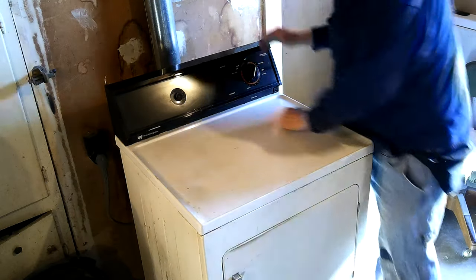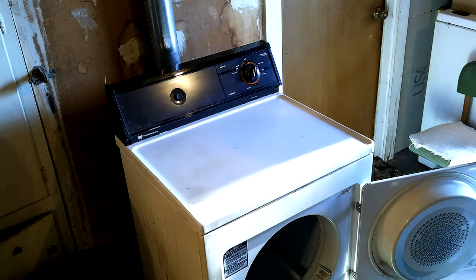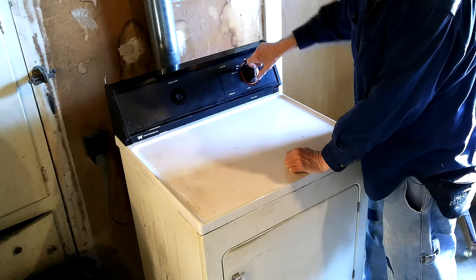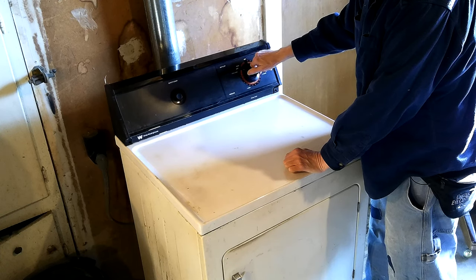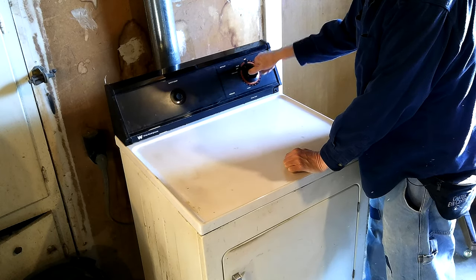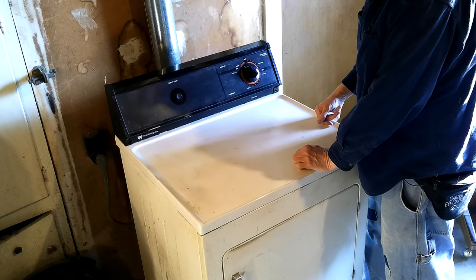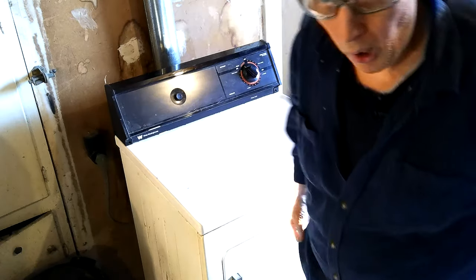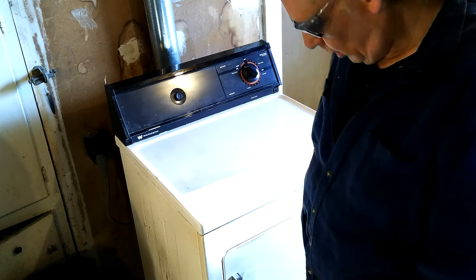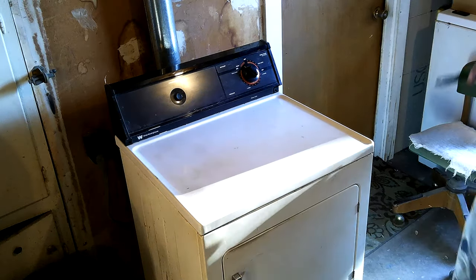Okay, that's hot enough - I'm starting to feel the back warming up. Hopefully that burned off that oil. Let's turn it till it quits and get it running again on air fluff for a minute, let it cool down. You definitely don't want that brand new heating element to overheat. When there's no clothes in there, it can get too hot. With the clothes and the moisture in there, it's going to not let it get too hot, you know.